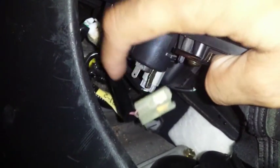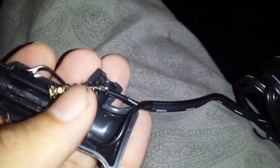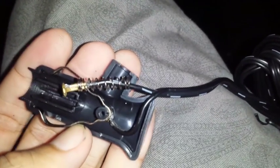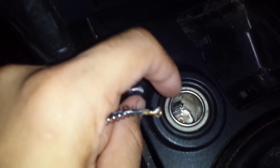I'm going to be stripping the wires and placing them onto these two terminals. I've just dismantled the 12 volt plug and there are two wires in there. One's positive, which is this one with the lines on it, and the other one is negative. It's important to identify which one's which so when you connect them up to your cigarette lighter you have them in the right spots. The middle part is positive and the side is negative.